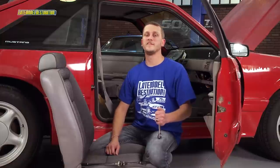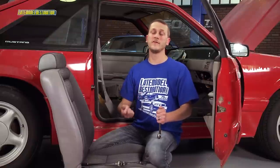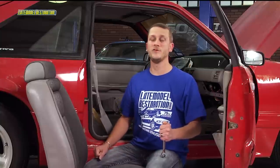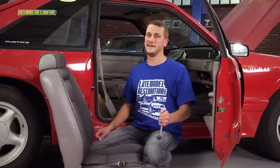You'll notice we completed this job without taking loose anything with the AC. Now, if you were to have your AC system evacuated, you could disconnect the accumulator and your liquid line from the evaporator and pull the box completely out, giving yourself a little bit more room to work. A couple of other things: you're going to want to have a drain pan to catch any coolant, and after you hook your heater hoses back up to your new heater core, check your engine coolant and top it off. Please feel free to leave a comment if this video was helpful, and if there are any other videos you'd like to see from latemodelrestoration.com.